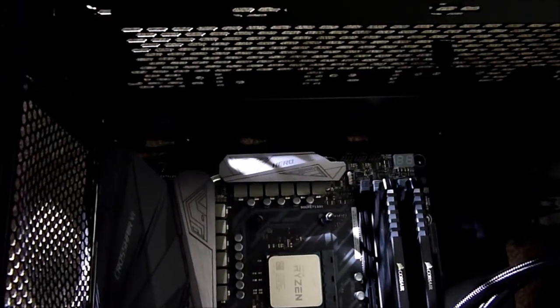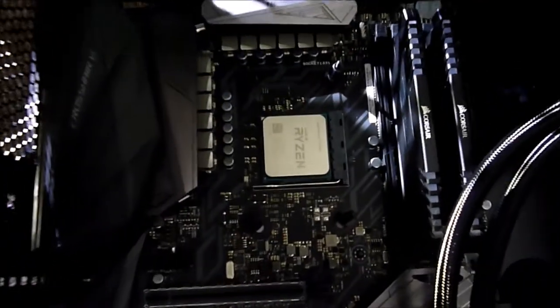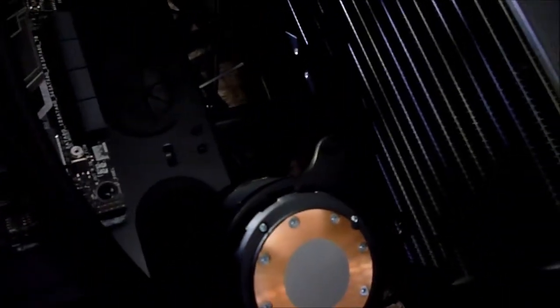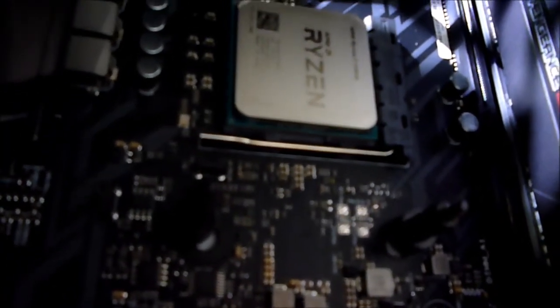Just another little catch-up for where we're at. While the video was paused I've got the motherboard in, the processor is now in, the RAM is in, I've also put in the M.2 SSD, and if you look to the right-hand side there's the 240mm radiator — I've put the AM4 retaining bracket on. I can see I've removed the standard retaining clips and put the retaining bolts in.